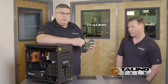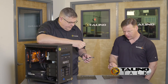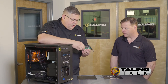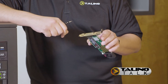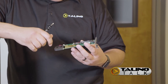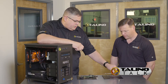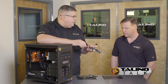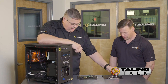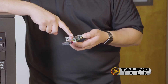We also have one that we're going to install for four PCIe M.2s. The good thing with our brand new cards is that you can install multiple M.2 SSDs on a single card and have it only take one PCIe Express bus. With this one you just have a single lane — you can only install one M.2 PCIe SSD. With these, you can install one on this side, one on the other side.